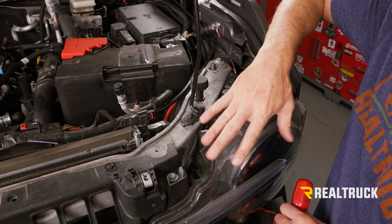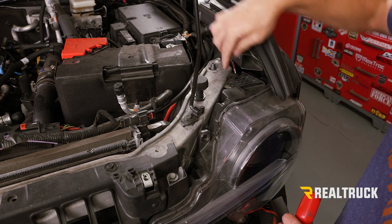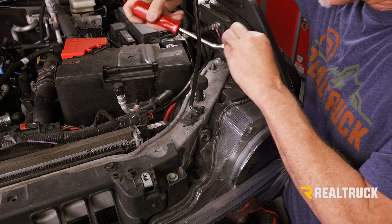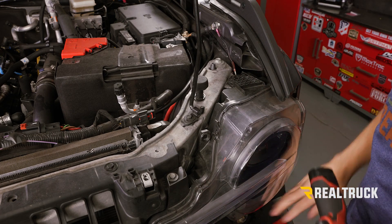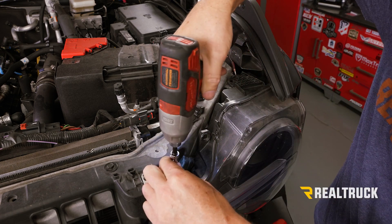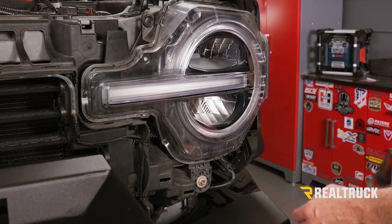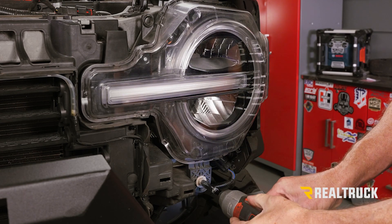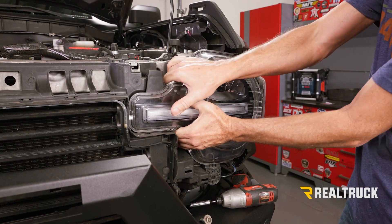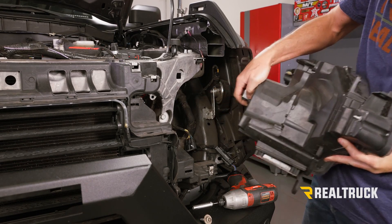Right now we're on the driver's side. What we do here on the driver's side, we'll be doing the exact same thing on the passenger side, just as a mirror image. We've got a couple of bolts to pull out and also a plastic push pin. We're going to take the push pin out first using a fastener removal tool, and then a 10 millimeter to take out the two bolts. Now we've got one last bolt holding this in, so we're going to go ahead and pull that out with an eight millimeter. The only thing holding it in now is just clips, so we're going to pull it back. Once we bring it back, we can go ahead and disconnect the harness and pull it out of the way.